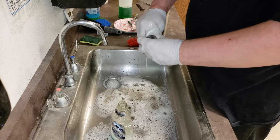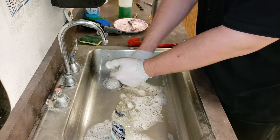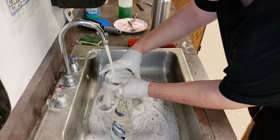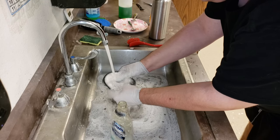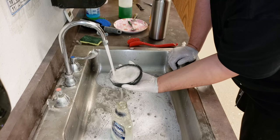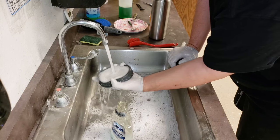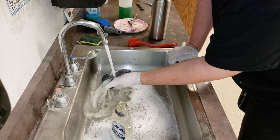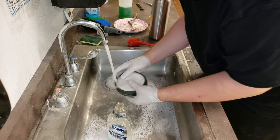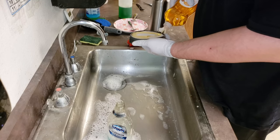Still more dirt coming through. Just give it a really good squeeze. You can see the foam is turning brown. The filters on these only work if the bin is emptied on time, just like with every bagless machine. That's why for anyone who doesn't want to maintain filters, I recommend a bagged machine, such as an Oreck. Because all they need is the bag replaced here and there, because the bags are huge and it takes forever to fill one. Still getting dirt out. Let's give it another bath and some more dish soap.